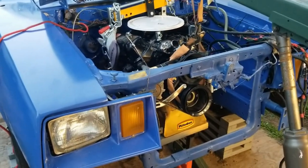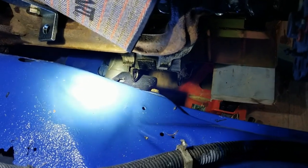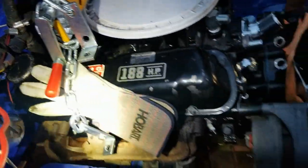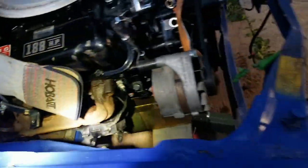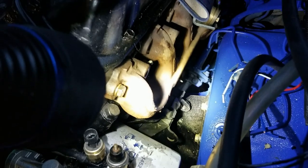I decided to skip putting the flywheel on for now. Not quite getting as far as I'd like. You can see the motor mount - there's two inches away from finding home and we're right up against the firewall, scratching my paint. It can't go back any farther, and I know it's gonna have to go down an inch or two. I don't think that's gonna help much, so I'm a little worried that these Mustang II motor mounts aren't gonna do it.